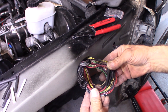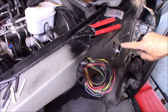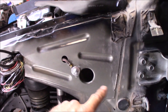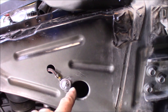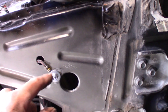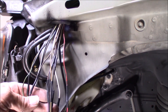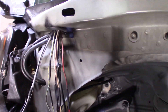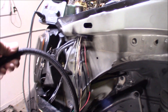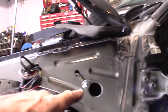Now with the harness all pretty much the same length, when I pull this back into here I'm going to pull a loop down into here, ready to pull it back into this channel. For the ground wire, I drilled a hole right here, put a quarter-20 bolt, and took off the paint to get a good ground — I'll shoot that with some black paint to keep it from rusting. Over here I did the same thing — got all the wires soldered up color for color — and I'll put this loom on it up into here and pull some of this length back into this channel.